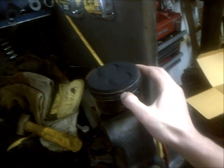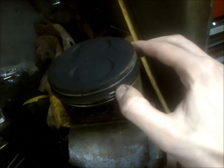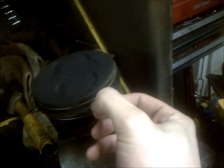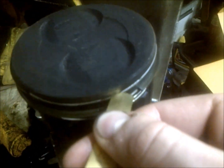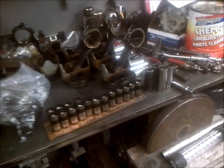What you also need to consider is your ring up-and-down play — not ring gap, but the play in the ring slots. That needs to be within 2 to 4 thousandths. If you can get a number 6 feeler gauge in, then it's too much. If I can slip this feeler gauge in — which I can't — then it would be too much and I couldn't use these pistons again because they show too much wear in the ring slots.